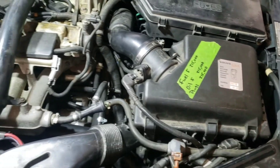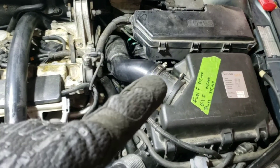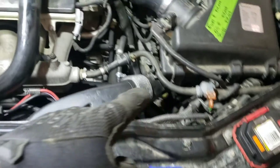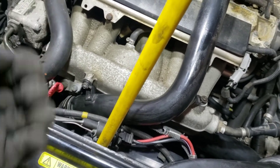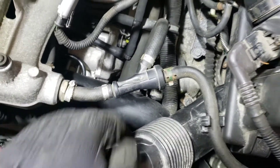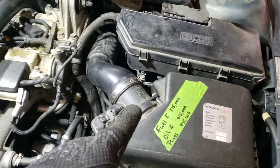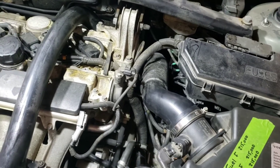I've got everything put back together. Pushing smoke through here: it goes through the turbo in the back, comes up through this tube, through this connection into the intercooler, through the intercooler, and then back through the intake tube which goes to the throttle body underneath. I found that this tube was not fully seated up underneath there, so I got it pushed back up. I blew smoke through again after fixing it and it held pressure, then buttoned everything up.